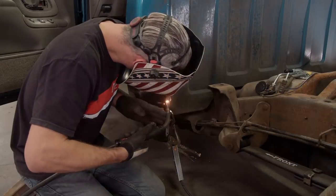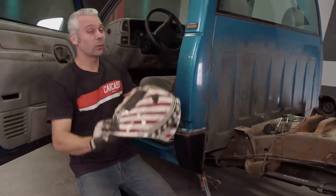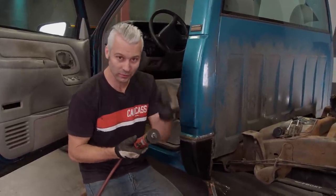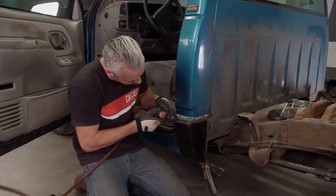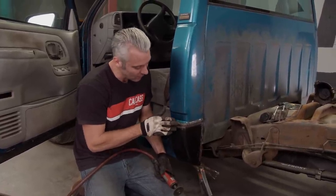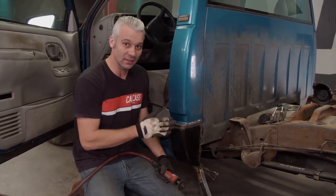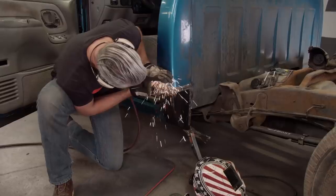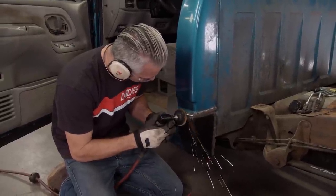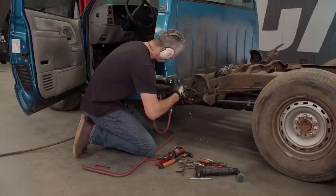From there we'll fill in the holes with some rosette welds. We're all welded up and it's time to move on to a very crucial step — grinding. We've stacked up two cutoff wheels to give us a little more thickness, and we're going to lay the grinder across the weld. As we grind, we'll pay attention to when we touch the top or bottom part of our metal and then stop or move on quickly. We don't want to take too much material away and chance this cracking down the road. Then we'll come across it with a flap disc to smooth out the line — a smooth line means less body work.